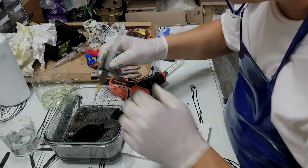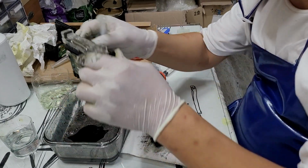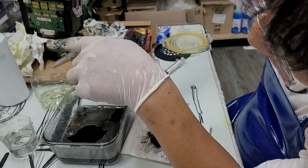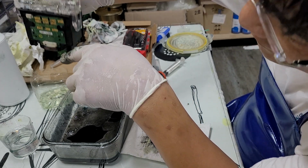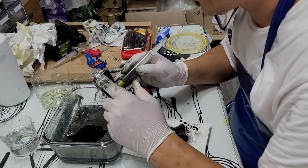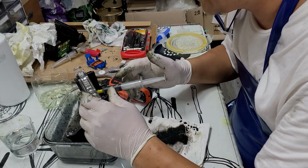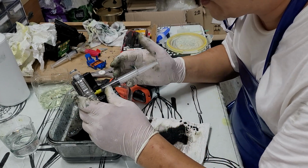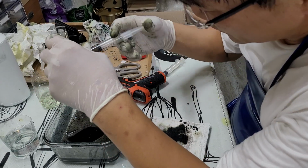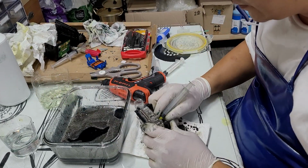But, you know, when that happens, you can soak this printhead. Put the solution about this much and then soak it for like 30 minutes up to 2 to 3 days, but don't go more than 3 days. The film is going to peel off later if we soak too much. Yeah, just unclog that thing right now.